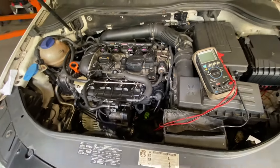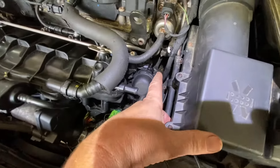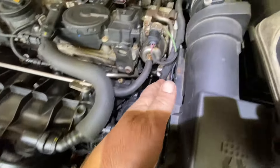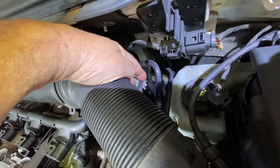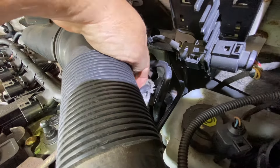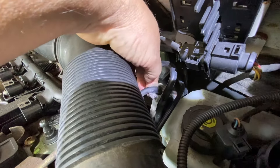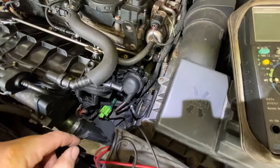Getting back to the code — if the manifold looks fine, then you have to make sure your vacuum source is fine. You see where this line goes? This line goes up and it goes to the vacuum booster right here. There's a T right on the top over here — make sure it's not clogged, make sure it's not cracked. It looks like an F with two or three ports to it. You follow the thin wire with insulation — that comes around here and goes to this valve. Make sure it's not clogged.